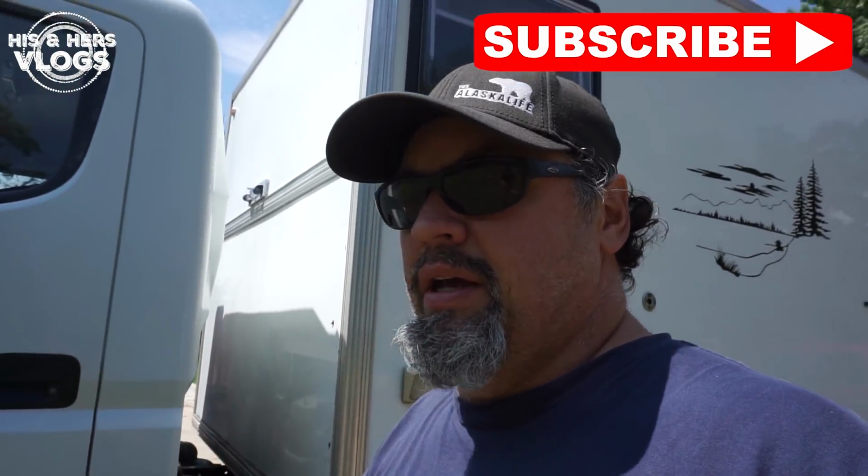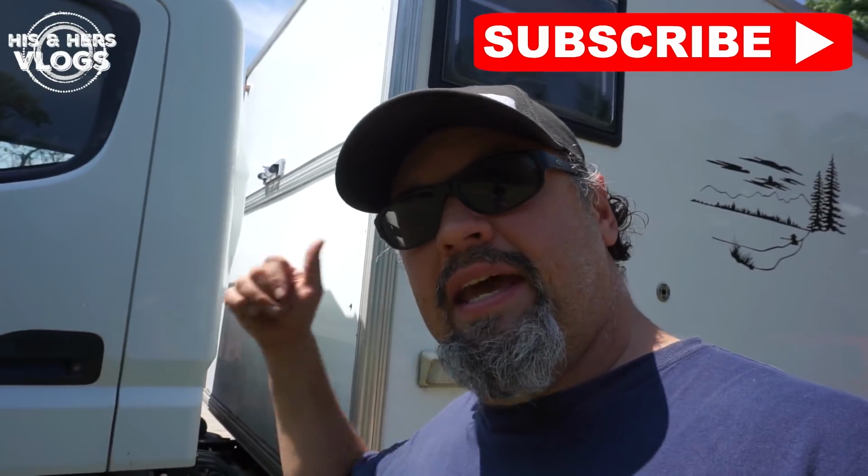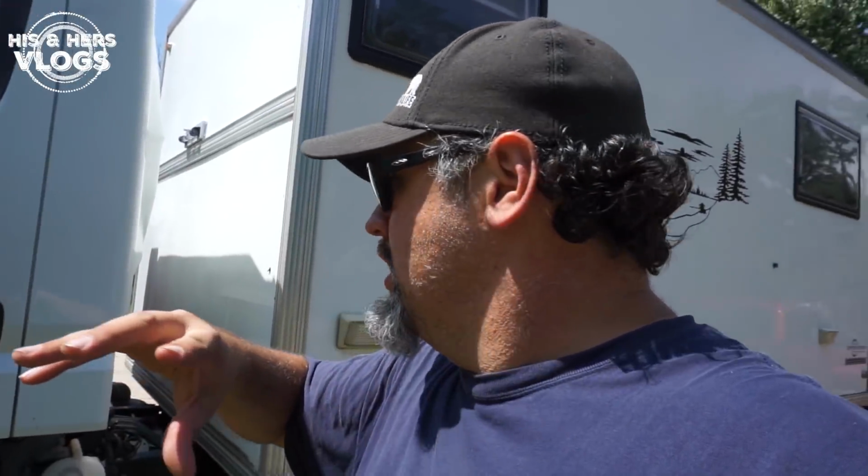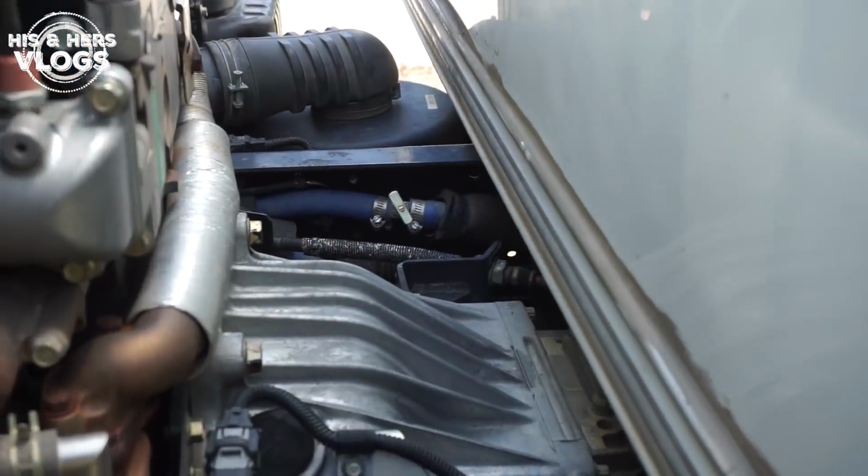So this vehicle has a heating system off of the heat of the engine and a diesel fired furnace. What that means is that there is hot water as part of the circulation going through here at all times. And in this heat, we've been finding when we get to the end of the day of driving, it is sweating hot back there because it's essentially like radiant heat from all this PEX tubing. And there is a solution.